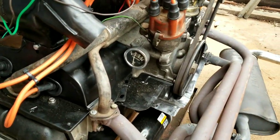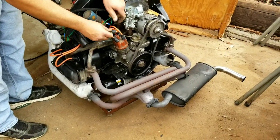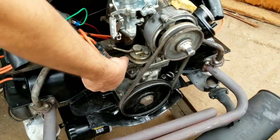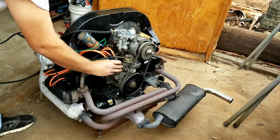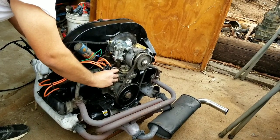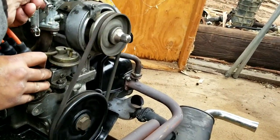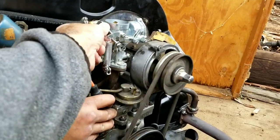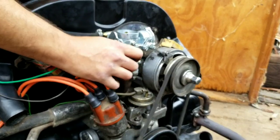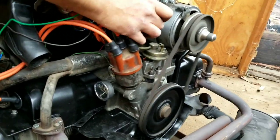See, we're up to about 20 pounds of oil pressure on crank. Not bad. Okay, check our spark real quick too. Yeah, we're going to check our spark because we didn't see it fire right away. Sounds like we got spark. I hear it. Should be timed. We have fuel? There it goes. It's thinking about it. There it goes. Started.